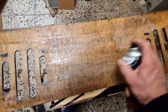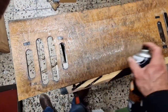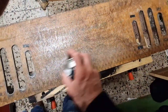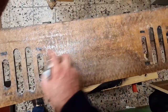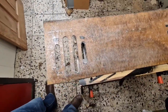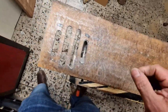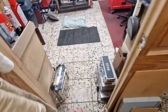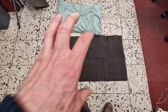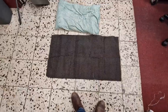It'll allow me to pull up and lay down the speaker cloth if I need to, without it being stuck permanently forever as soon as you put it down. So I'll give it a really good smothering in the carpet glue. You don't want it too thick in one place so it might come through and be visible on the front. I tend to give it a reasonable good dosing so you get more of a spider web effect than thick gloopy glue. Let this go off for just a second. I've cut the speaker cloth quite a bit larger than needed. I'm going to line it up along the bottom and get it stuck back down.